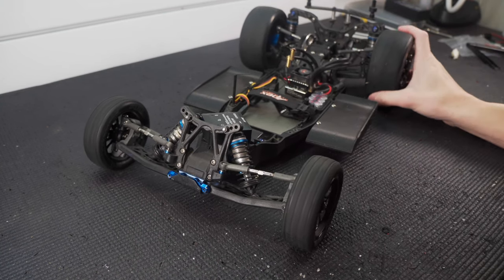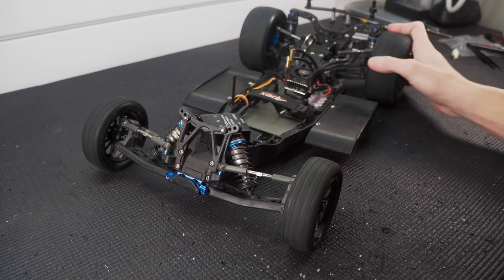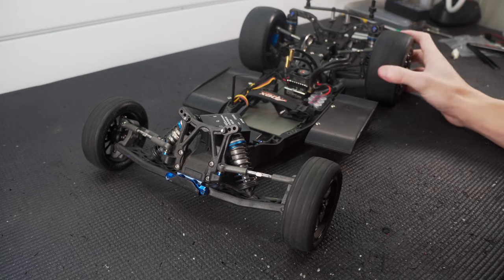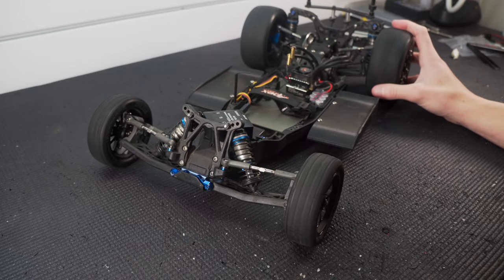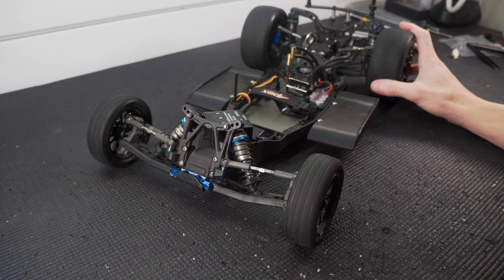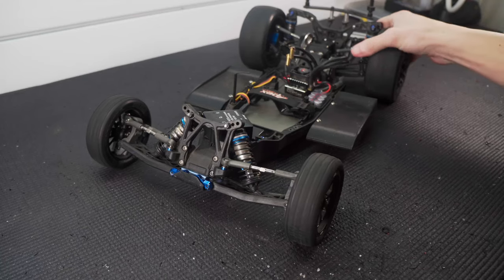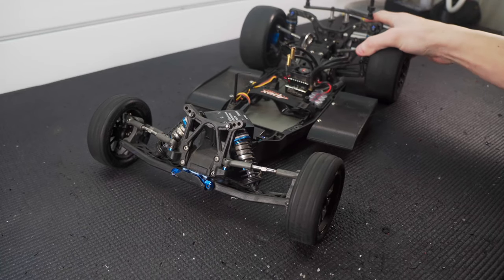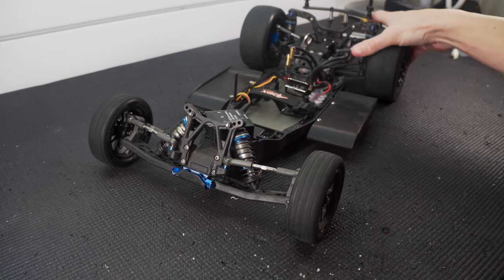And I know I've talked about in the past that I kind of want to stay no prep and stay dry on the tires and don't want to use any tire prep. But I'm thinking about looking into some tire conditioning. I don't want any sticky stuff, no prep, but I do want to condition the tires. That way, they're better set up to launch right at the beginning of the day. I don't have to get 7 or 8 passes in before the car's really hooking right.